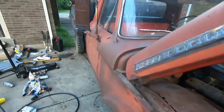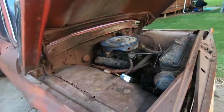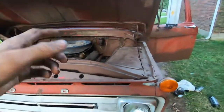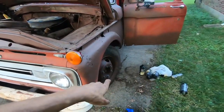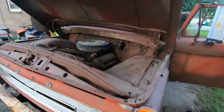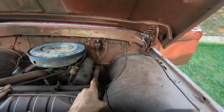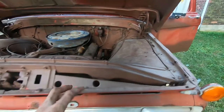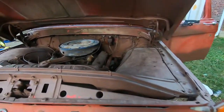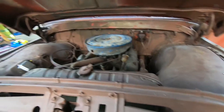All right. Brakes back there are done. I did find that I have one tire that's off the bead back there, but we're not really driving right now. We're probably going to get all new tires for this. Pretty sure the tires are ancient, but they're not original, I know that. Anyway, a buddy came over and helped me bleed the brakes. I've adjusted them a little bit. Fronts might still need some adjustment. The rears I think are pretty good, and the pedal is not awful.